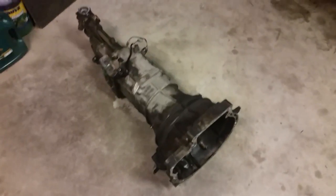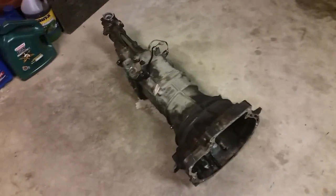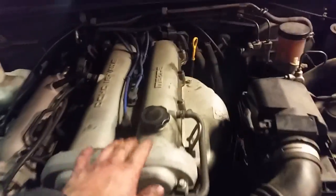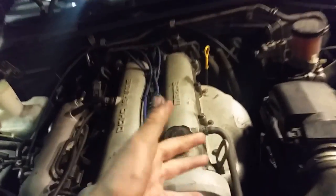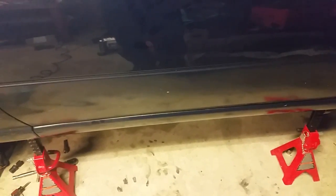Here's why I put that rope up there — see that? It's just hanging on that rope. I took one bolt on the bottom out, and there are two that have nuts on each side. I got the transmission out — with the help of two other people. You're going to need a buddy. The transmission is about 80 pounds, so be careful.